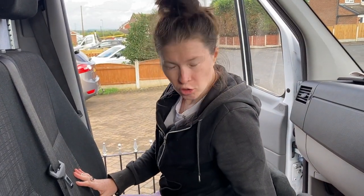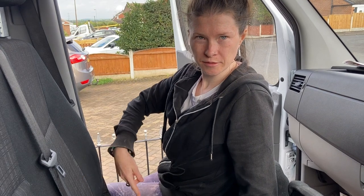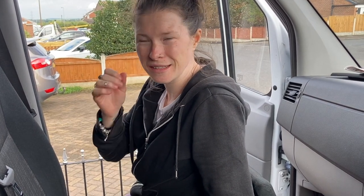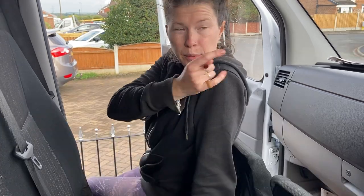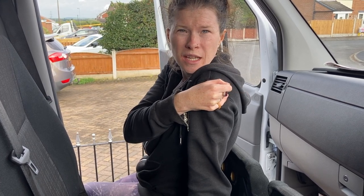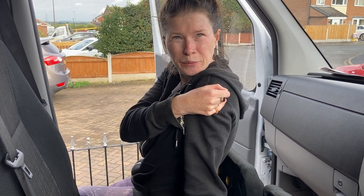We've got all the wires run through in the right places — it took quite a bit of faffing because we put protective conduit on the section that goes under the floor, so it's not rubbing on the cables. We had to take them out and feed them back through a few times, but we've got them in the right place now. What's left to do is fit the B2B charger in place, connect the cables underneath it, put the two negative cables into the negative terminal of the starter battery, put the fuses in, and then we're good to go. Then we'll go for a drive and see if it works.